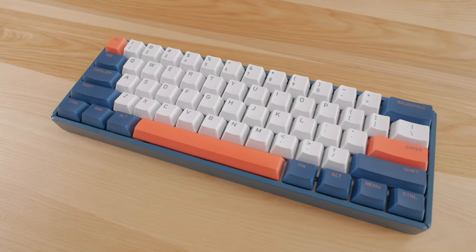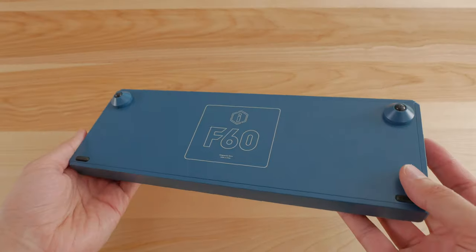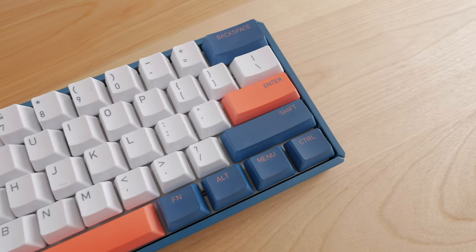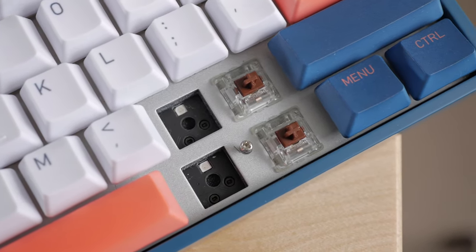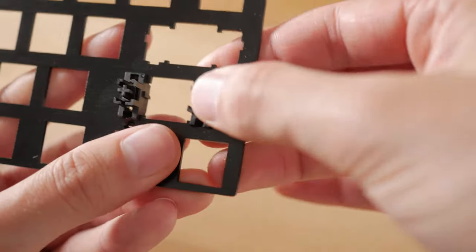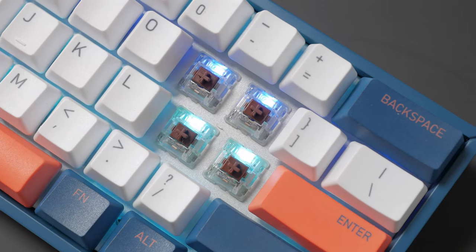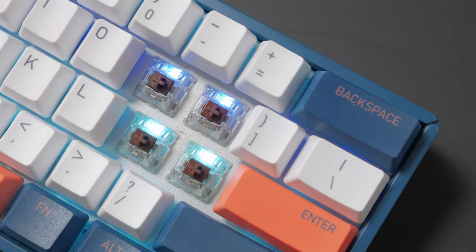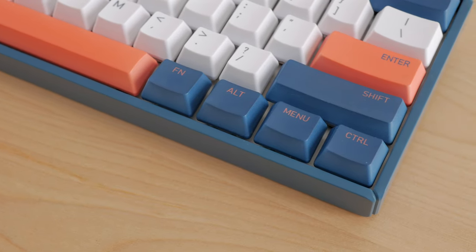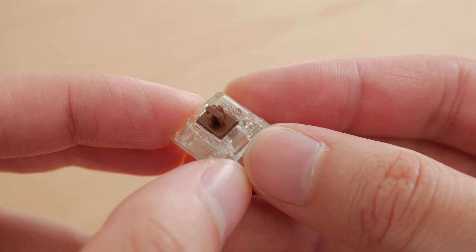In conclusion, I like a lot of things about this keyboard. The build quality is definitely the biggest plus — the paint job on the aluminum case is flawless, the overall design looks nice, and the theme with the keycaps looks very good. I also like that it features hot-swap switch sockets and came with sound-dampening foam pre-installed, as well as factory-lubed stabilizers. In terms of downsides, I wish the stabs were Cherry-style instead of costar type, and I wish the PCB allowed for 5-pin switches. I hope the dead green LEDs on my unit is a very rare issue, and I hope the software will come out soon. At $129 without LEDs and with basic Cherry switches, I think this is decent value for the money, as long as the software comes out eventually.